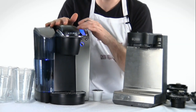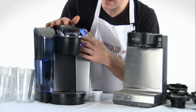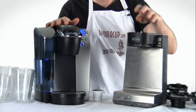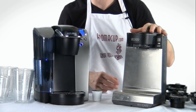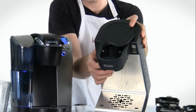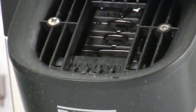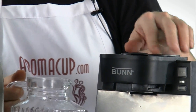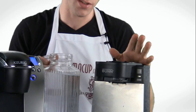The B70 allows you, using this LCD menu right here, to choose the brew cup size by simply pressing one of the left or right buttons when the machine is ready to brew. You select a cup size on the screen and then start brewing. On the MCU, things are a little different — it's definitely more manual when it comes to choosing your cup size. You need to actually open up this water tray on top of the MCU, and you'll see markers showing how many ounces of water you can add. Bunn specifically says not to use distilled water — use filtered water, as the minerals help the flavor of the coffee. I've never really seen that in a manual for a single-serve machine before, so that's sort of a first.